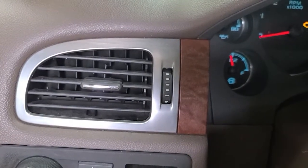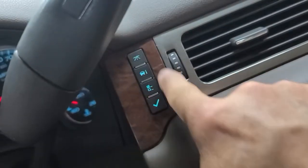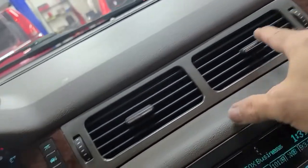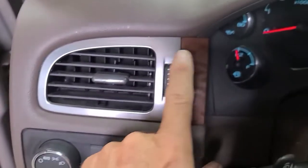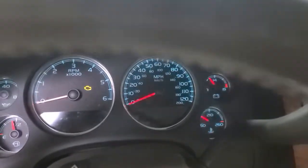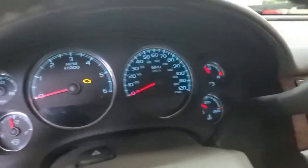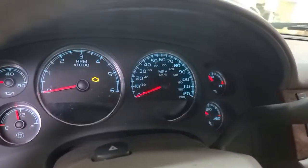I'm going to remove this air conditioner duct right here — the shroud in the front — this piece and this piece here. We're gonna pry up this section here as well as about halfway down, so we can get to two screws that are under each of these. Underneath here there is a screw right there and a screw right there. Those are gonna have to be removed, then we'll remove this inner bezel and then we'll be able to get to the screws that hold the instrument cluster.